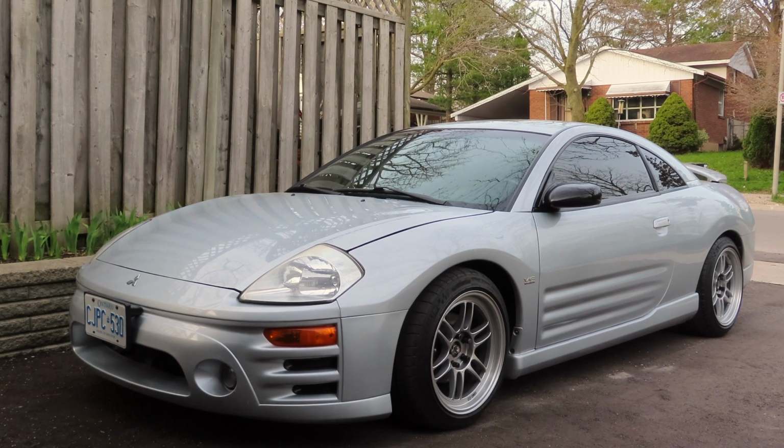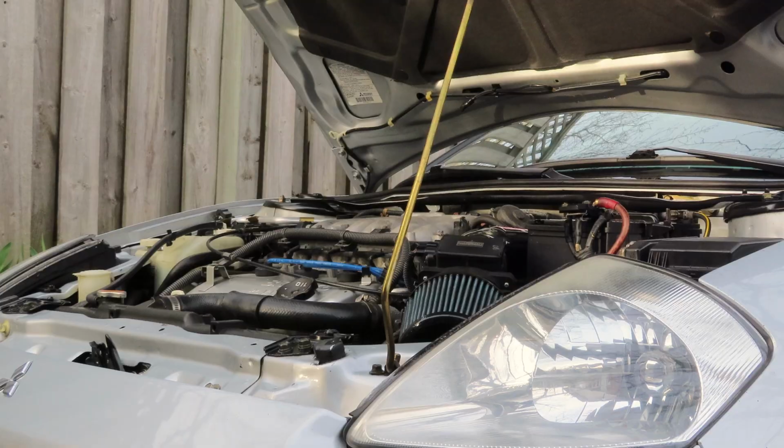because there's going to be more stuff getting in your oil, making it more dirty, and that's not good. So you're going to need more frequent oil changes the harder you drive. If you're more of a light on the pedal type of driver, you probably don't have to change your oil as much. I like to change it every 5,000 to 8,000 kilometers. My logic behind this is the more often that you change your oil, the less dirty that oil will be. So essentially, when your car is running and it has oil lubricating everything, that oil through function kind of gets dirty.